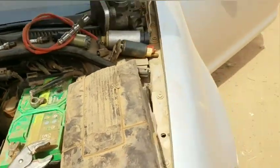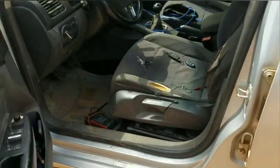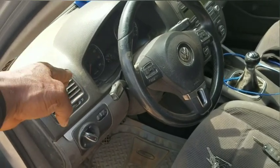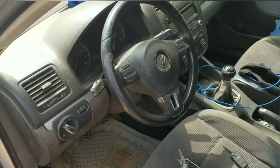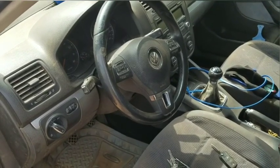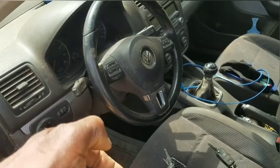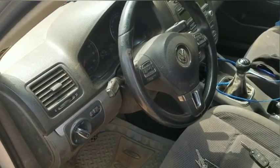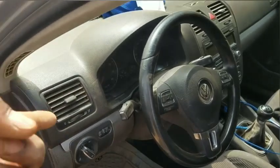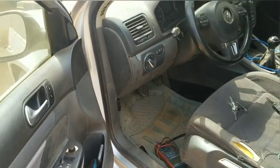But for Toyota models and some others, if you start the car after resetting all this and you start seeing a surging idle, or the idle starts going down, have it at the back of your mind that resetting can also trigger other malfunctions, amplifying every other malfunction that has been existing but has not been present enough for the onboard computer to record it as faulty. So at that point, you should be ready for the worst case scenario.